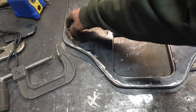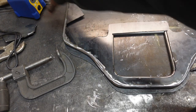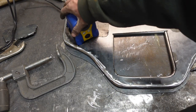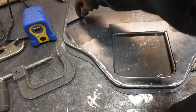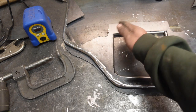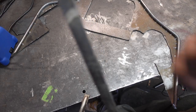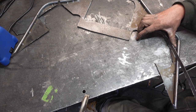I'm thinking for these parts, there is no way that I will be able to bend that perfectly, and the parts already barely fit as is. So I think I'm just going to cut a strip of 16 gauge at a half inch, bend it around, and weld it in that way. It'll still look cool because I'm still going to grind down the edges — it'll be a whole lot easier that way. Got me a nice chunk of finger cutter here. Let's start sticking it in here.